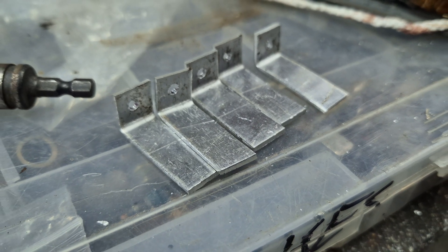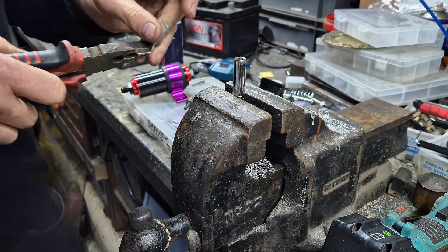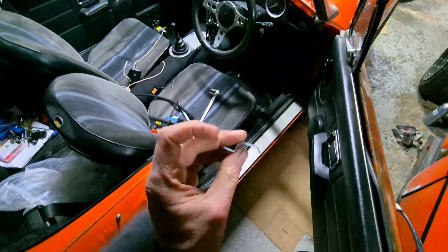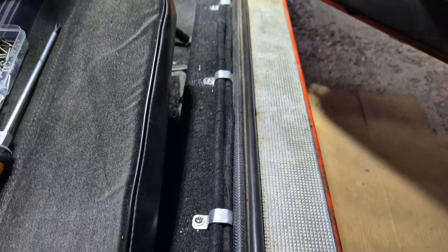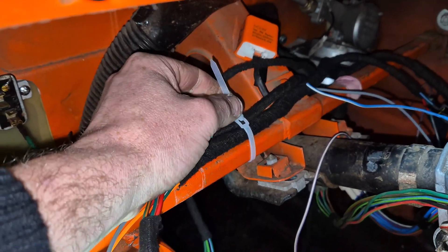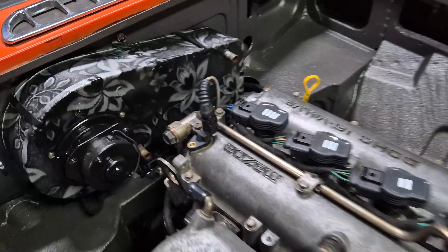When it comes to holding your battery cables down, I've found it's just easier and neater to make your own clips. You can see these 90-degree little pieces of aluminium I've cut up and bent from two-millimetre thick aluminium, bent around an eight-millimetre socket to get a nice curve so it follows the contour of the cable. These get screwed down into the sill and they hold down the power cable and the rear loom as well — so if I need to change anything, it's all quick easy-access stuff that I don't need to take a carpet out to get to. Also, rather than taping or using normal cable ties, get yourself a set of quick-release cable ties — they allow you to add and remove the loom as many times as you want without having to cut or get sticky residue everywhere.